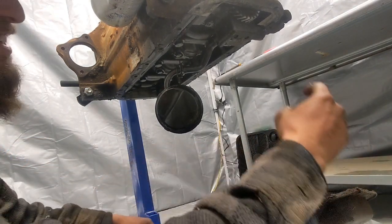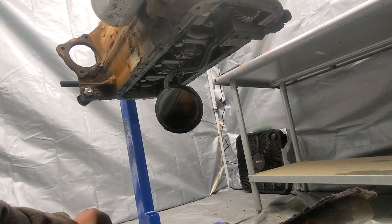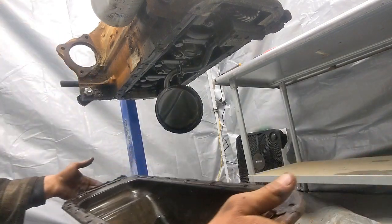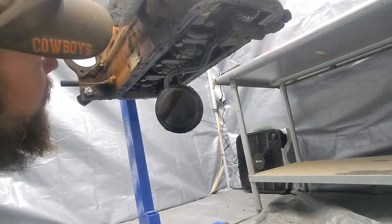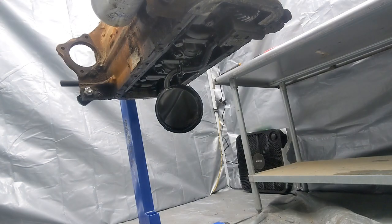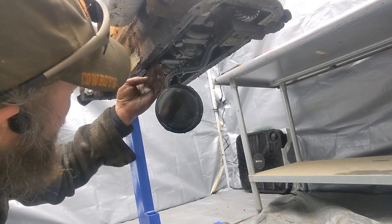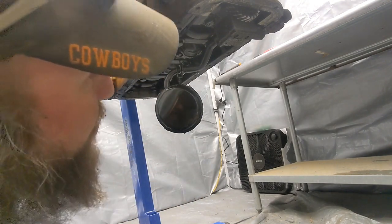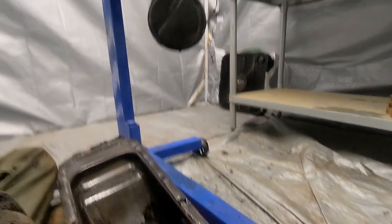Be careful on the front end here because there's your oil pump right there - don't hammer into that gear. Yeah, it looks like this is done exactly the way they recommended. It's a multiple-piece gasket. The rest of the oil pan gasket is still on there, but the front and back with the Permatex on it came off with the pan.